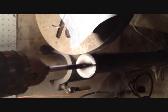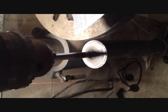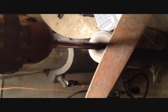The first one I did had some pitting, but it wasn't very in-depth pitting. So, what I did was I was able to just use a file and literally turn the drill press on and file it like this. And you've got to use your brain. Don't go against the angle of the valve. Use the angle of the original grind and just get to where the file feels like it's hitting it all, and then just put light pressure on it.